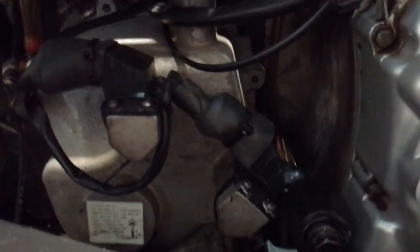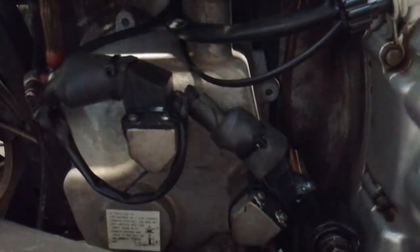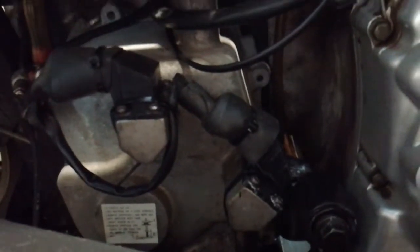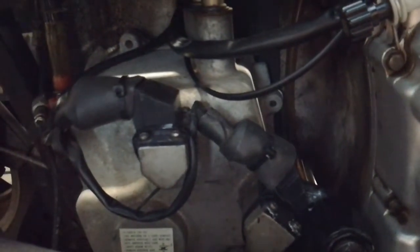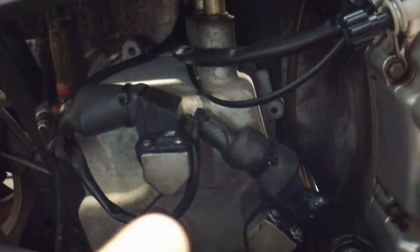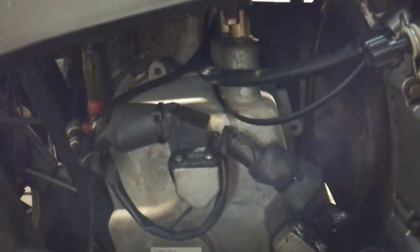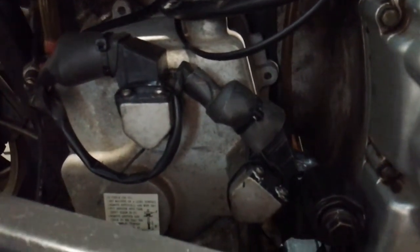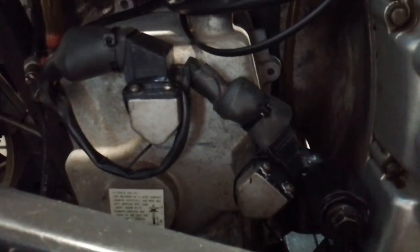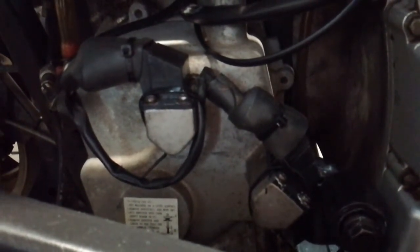Both of these are just regular electrical switches, which sit in a well. There's a rod that comes in with different notches in it, and they either move the contacts of these switches up or down to make contact or remove contact and electrical flow. That's what lights up your neutral and reverse lights and allows you to start your engine. If you don't have your neutral switch working, you'll need to take these off and bend the tabs until it works correctly, and it'll allow you to start your engine.